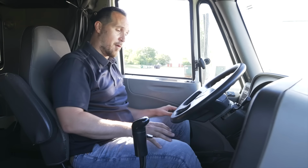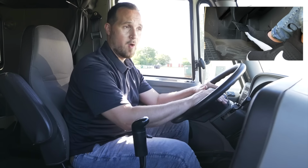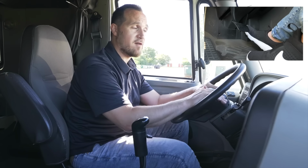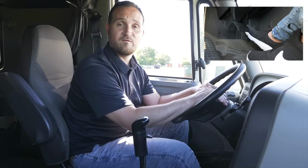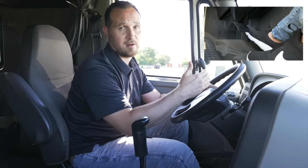We're going to do step number one on our lab test. I will hold the service brake down with my foot for 1 minute. While I'm holding it down, I should have no leaks, no more than 4 PSI in that 1 minute. Either I'm going to count that minute out or have my examiner time it out. So you do have to wait that 1 minute. So let's start counting.